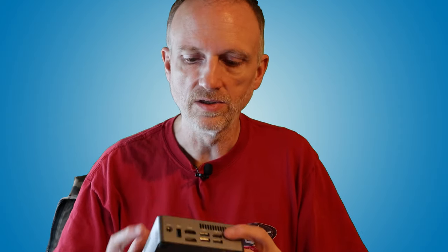One of the nice things about this is 5 USB ports as opposed to 4 on the other one. All of them are USB 3 and they're all on one side. If we look at the Kodlix, we have 2 USB 3 ports on this side with a USB-C, and then we have 2 USB 2 ports on this side. So they're on opposite sides. Not a huge deal. When I had it on top of the OTA, I had a couple coming in on this side, a couple coming in on that side. The only one that needed the USB 3 was the imaging camera.